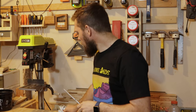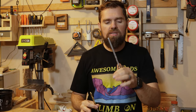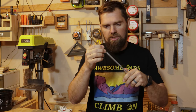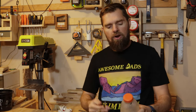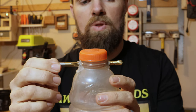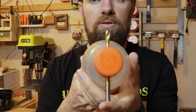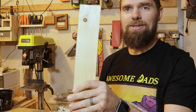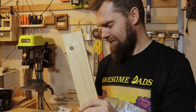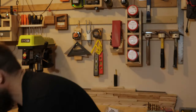This file is used so we can grind this notch right here, and we're going to grind about halfway through this tube. Once we have that ground halfway through the tube, we're going to need a drill bit. For this blower it is a 5/16-inch drill bit. If you don't have this exact blower, you just take your drill bit set and put that bit right up on the end of the tube and see what is the same size. We'll take this drill bit and our hand drill and drill a hole through this bottle.